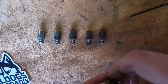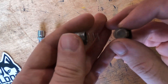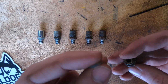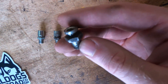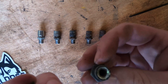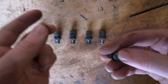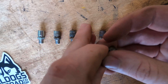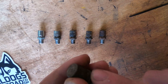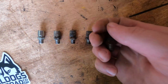This design is inherently flawed from the factory, and almost everybody who doesn't replace their factory breather ends up having to replace their axle seals sometime down the road. Here's what the inside of one actually looks like — here's one we pulled apart. You can see the cap comes off, and you have a spring and a little piece of rubber, and then you have the breather piece that screws into your axle. It works fine, but for how easily it gets rusted shut, it's a design flaw that needs to be addressed.